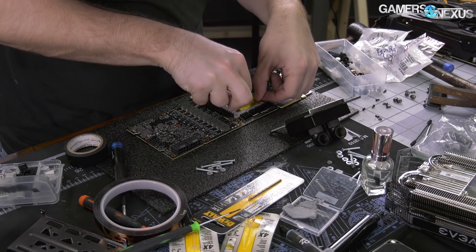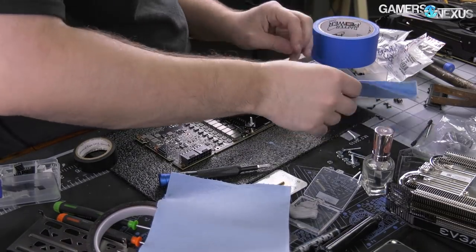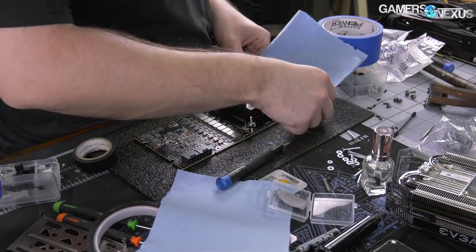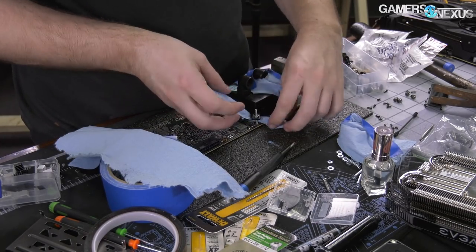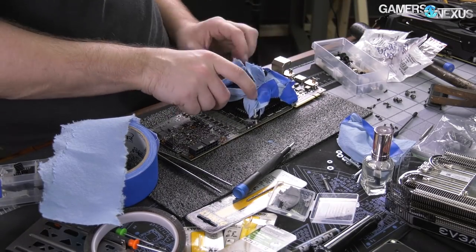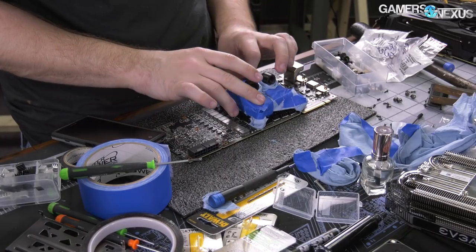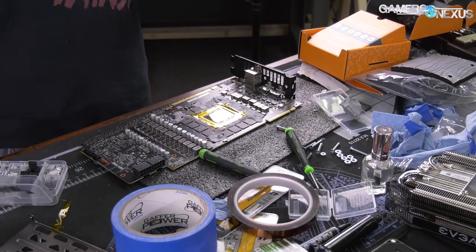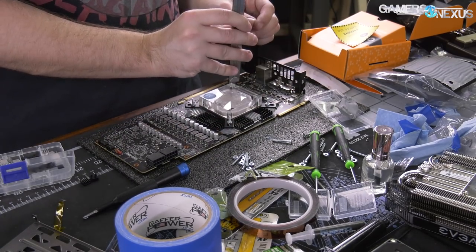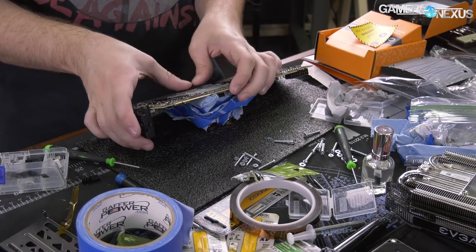Just for some voiceover here - this is the part where we started insulating things and it took a long time. What we did was blue shop towel on everything. The ultimate goal is to stop air from hitting stuff, but if air does happen to hit something then hopefully the shop towel catches it, and hopefully the kneadable eraser underneath will also prevent any drips from hitting PCBs or circuits. This was done for both our EVGA XC Ultra and our ASUS Strix cards. We also got the backside because the backside runs below ambient. We used Kapton tape - that yellow tape along the outer edges of the GPU - to cover all the small SMDs that surround it, because water will form on the cold plate if air can get in.